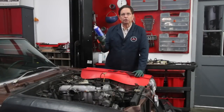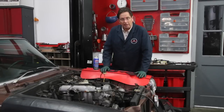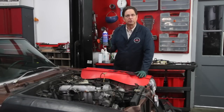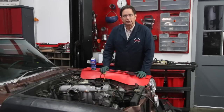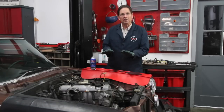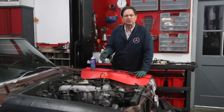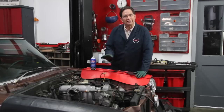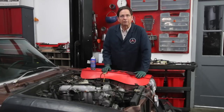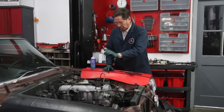I'm going to use a rust neutralizer to treat all the rust spots before I top coat them with an enamel — a satin black — but I need to clean off the excess loose rust first. When using a rust neutralizer, you don't want to remove all the rust; this product actually likes to stick to rust. It converts it to a black coating in preparation for top coat, which saves a lot of time. If you just paint right over rust without neutralizing it, it's probably going to peel off in a year or two. I'm using Scotch-Brite pads cut into various sizes to clean off the loose rust.